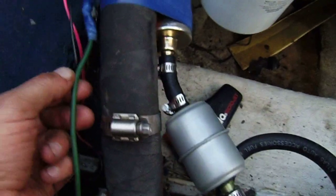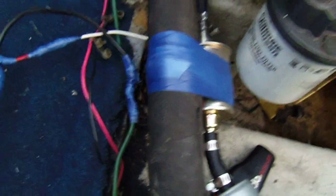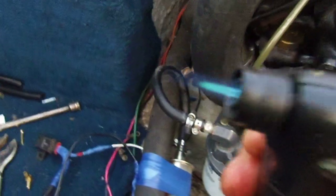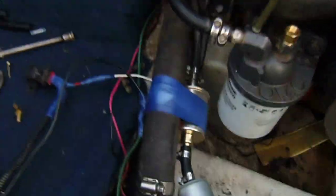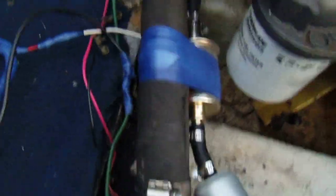You've got to install a fuel filter before the pump. For the negative ground, I found a real solid negative ground and got it coming off the pump into there. I weld my wires - when you get into heavy gauge wires, use this little torch here. Use your common household soldering paste and soldering wire too. Heat your wire, not the solder, until it gets hot, then just apply your solder until it melts.